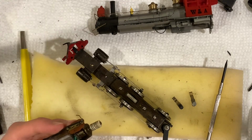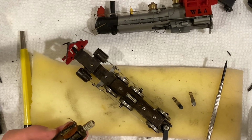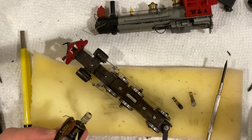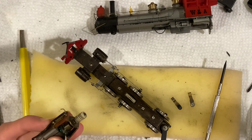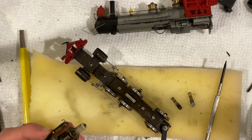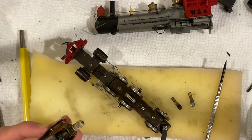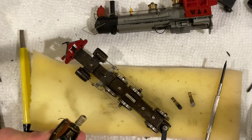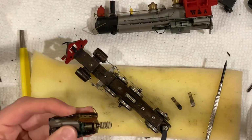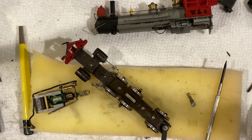But we are going to check the gaps, because if anything does get caught in there or any buildup of carbon, it can actually short the motor out. There's 3, 4, 5, and I'm going to do this with something softer so you don't accidentally score the actual commutator